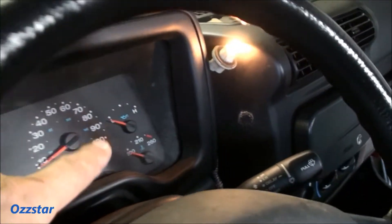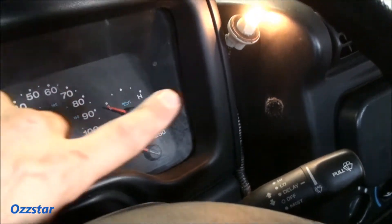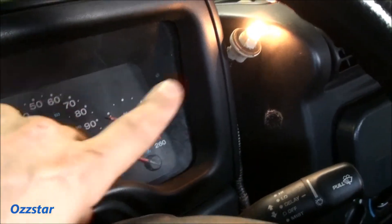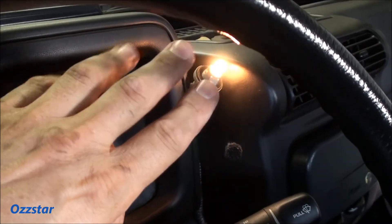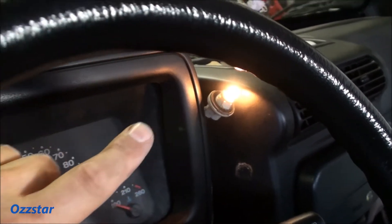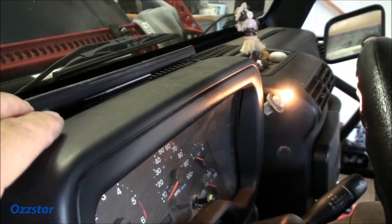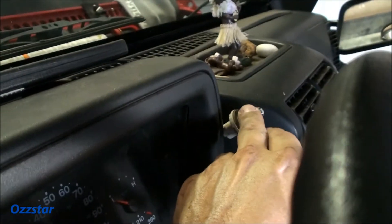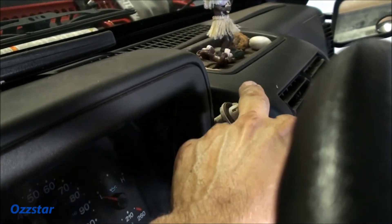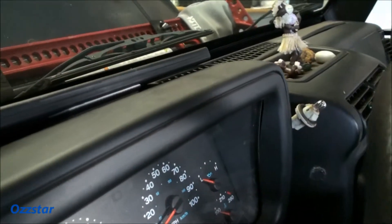So now we can monitor the grounds and powers to that TCM. I put the light right there so you can't miss it — check engine light is over here. If that comes on and we don't see this bulb blink or flash out even for a split second, then we know that TCM is shot — it's internal. That's how we're going to test it. I might put a little piece of metal over it to dim it down a bit since these get a little hot.